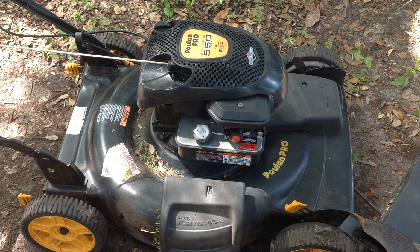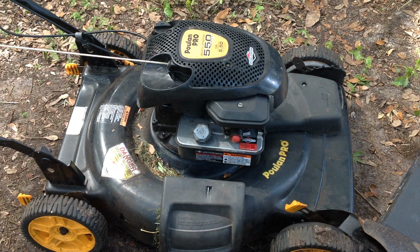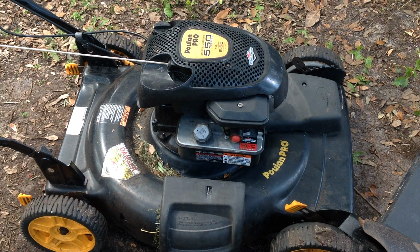I had to put a blade on it, and the brake cable was severely rusted. I had to put a new cable on it. It had difficulty retracting, so it was pretty rusty and stiff. Other than that, just a general cleanup. I cleaned up the engine case, spray painted that. Like I said, redid the carburetor, new primer bulb. And the blade was pretty rough.